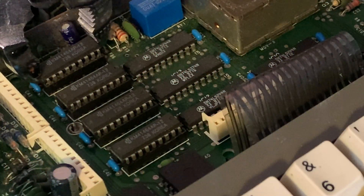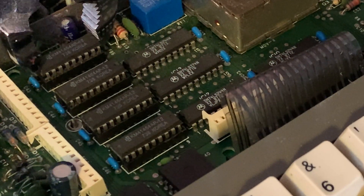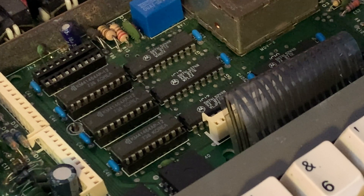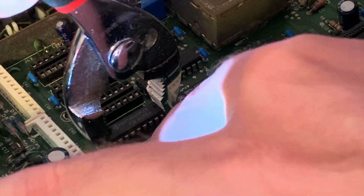I didn't want to desolder the whole thing. The next thing you've got to do is pull out all the existing memory chips. I don't have a chip remover, but I do have a pair of pliers — adjust the mouth to wide and you can grab those very gently. Don't squeeze, just let it grab, then wiggle them out very gently while keeping pressure on the board so it's not working the board too much. Remove those four chips and you're ready to install the board.